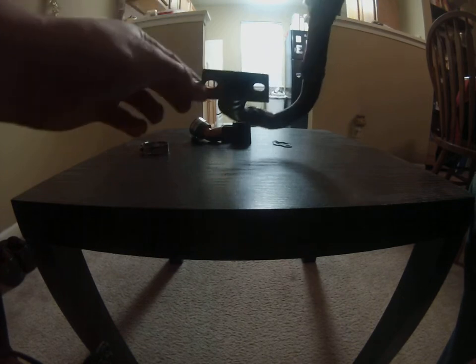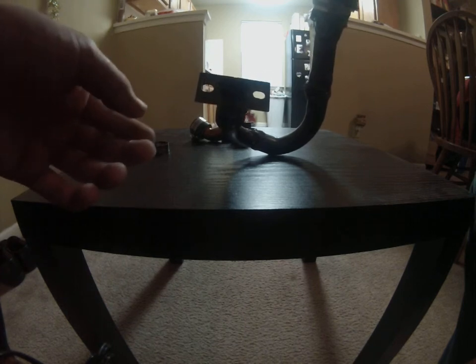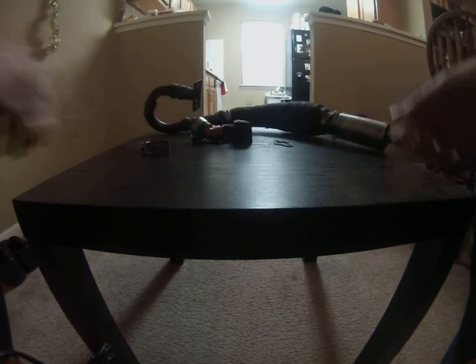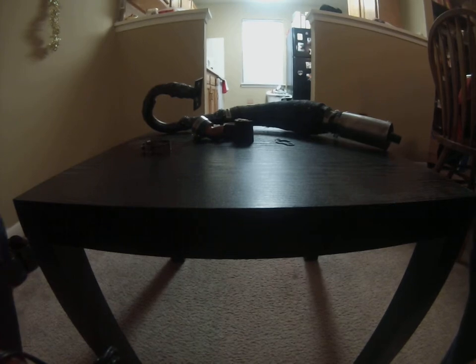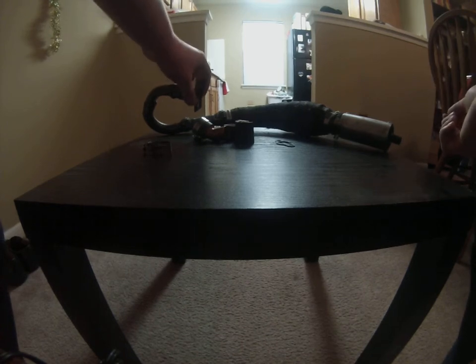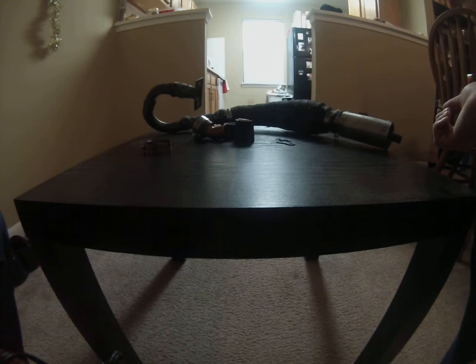You can see it's ported out here — it's not a great port job, I did that about a year and a half ago when I first got into the motorbike scene. When I first got it, the opening was the size of the stock exhaust gasket with no way it would flow well. My co-worker pointed out that the gasket is literally the same shape as a door lock plate — it fits up perfectly. So if you ever need an extra gasket, you can probably make one from a door plate.